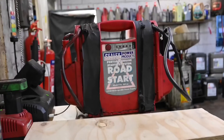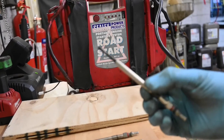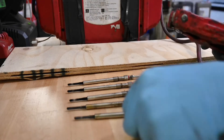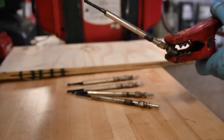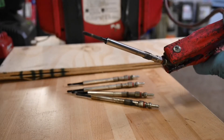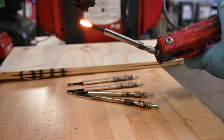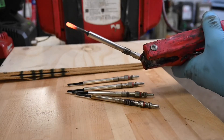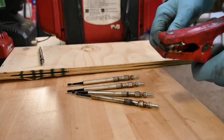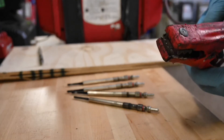If you've got a jump pack lying around, this is a really good way of testing the glow plugs and actually seeing if they work — if the tips actually light up and start to glow. Get the positive side of the jump lead and attach it to where the feed would be, and get the negative to create a circuit. Electricity will flow through the glow plug and hopefully heat up the tip. There we go — I hope you can see that, it is glowing away. Take it off straight away once you know it is glowing, then turn it off and it will start to cool down. Be very, very careful. That was cylinder one — the one we knew was absolutely fine with 0.5 of an ohm, so I expected that one to light.